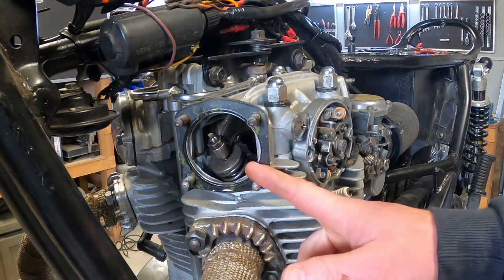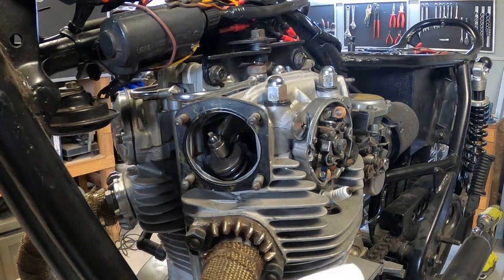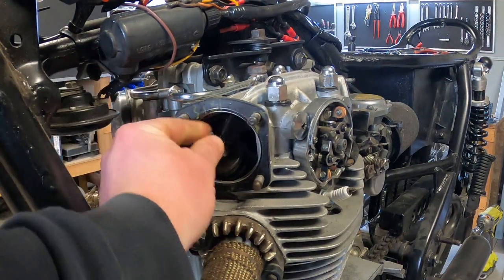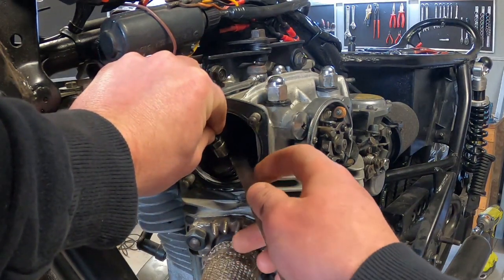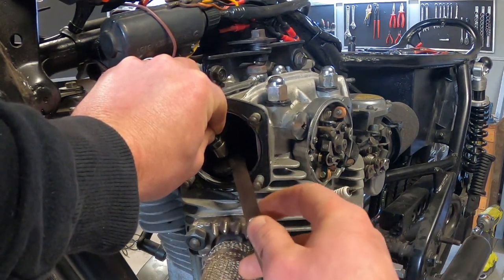Now we'll check the spacing on this valve, which is the exhaust valve. You're going to have to check your specs in the factory manual — different years of XS650 have different valve clearance specs. If you do have an XS1 or an XS1B, I've got it on good authority that the exhaust valve clearance listed is wrong and it causes excessive wear. It's listed as 0.3mm, which is quite large, and you're better off adjusting that to the inlet valve clearance which is 0.15mm. This one however is a TX650A and the exhaust valve clearance spec says 0.1mm. So you get your feeler gauge — that is 0.1mm. Just pull up on your rocker slightly and then see if you can get the 0.1mm feeler gauge in between the rocker and the valve.